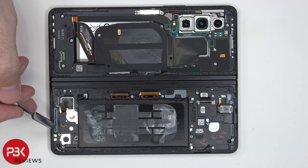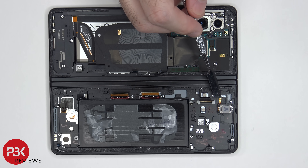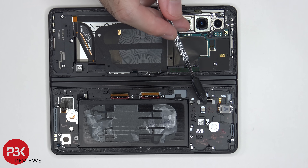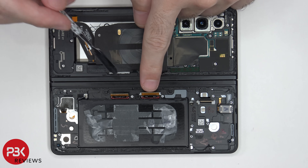On the lower portion of the speaker opening there's a rubber gasket with mesh filter, and there's also another rubber gasket and mesh filter on top. The earpiece speaker is located here and the flex cable for it is right here — the earpiece is held down with some adhesive. This is the screen cable and the flex cable here is for the S-Pen support. These two flex cables are held in place with a red rubber seal.